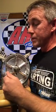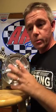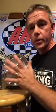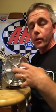You're not going to be able to tune this one with the coil gaps like you do the 6619s, 25s, and our other model flywheels. And you don't need as much timing advance. If you're running gasoline, these flywheels, the 6600s and the other ones I'm fixing to show you, the non-adjustables come set at 29 degrees. That's standard timing for the Animal PVL when it comes from the factory, but that's also standard timing for most gas applications. You're rarely going to get over 29 degrees, maybe 30, if you're running a higher modified race gas type application. But 9 out of 10 times, pump gas, low grade gas, you're going to be right out of the box just like it comes, at 29 degrees.